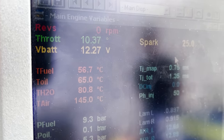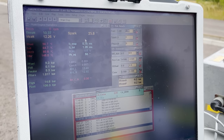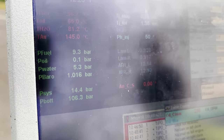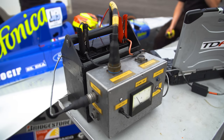The laptop gives you all your engine temperature, oil temperature, oil pressure, water pressure, and all the hydraulic side. Everything is hydraulically controlled — the throttles, the gears, the clutch — so you get pressures and temperatures for all of those. The engine is plastered in sensors everywhere they needed them, and they report back to the ECU, which overall controls everything and is in turn controlled by me. I can play with engine maps, injector timings, gear cuts — everything is essentially customizable. That laptop is your communication to the car.